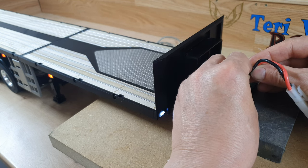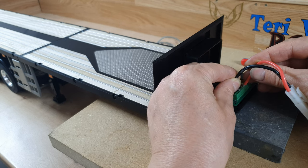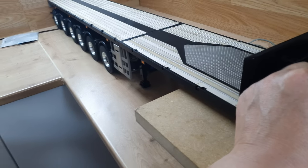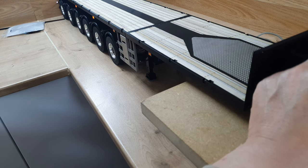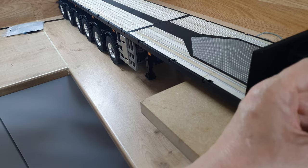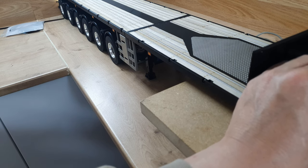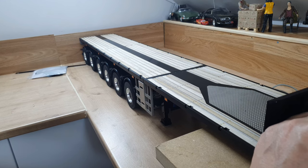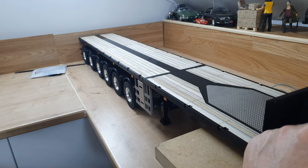Eight and nine are the front marker lights, which you can see just there. Then skipping 10 because that's not used, and then 11 and 12 are the rear marker lights — if I put you over here and probe them again, there you go, you'll see them at the top of the screen. That's the number plate lights and the rear marker lights. The reverse lights are the last two, 15 and 16 — you can see the reverse lights come on. The beacons are on five, six, and seven.